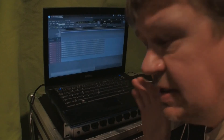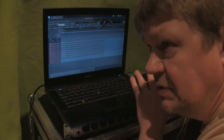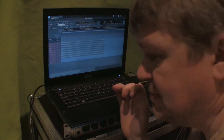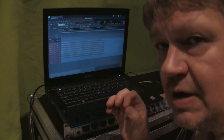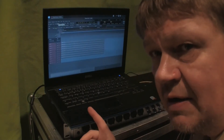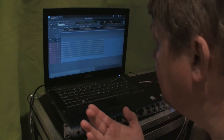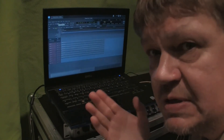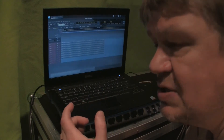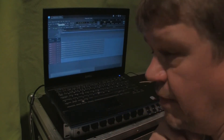Based on these few very initial tests, everything works very well. This is a known-good laptop, which means the Firewire chip and circuit in this computer is good. It seems that the Linux system is a little bit picky about these Firewire chips — there are different kinds of Firewire chips, and you need to have the right one. I've also tried with a slightly newer laptop that had a Firewire input. I installed Ubuntu Linux and found that Firewire just doesn't work in that — most likely because the Firewire chip is not the right kind. It's the same thing if you use Linux recording with a desktop computer: there you need to have a PCI card, which means you probably need a little bit older tower.